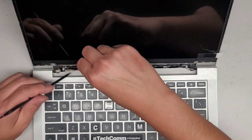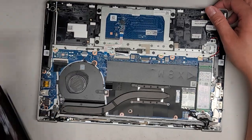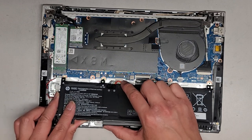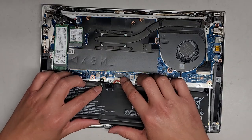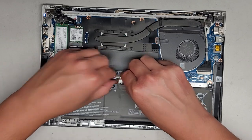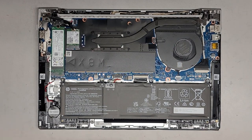First thing, we're going to test it before putting those adhesive strips back in, because we want to make sure it works — we don't want to put it all together and then find it doesn't work. Push the cable back under the cable routing guide. Get the battery back in, line it up. Make sure when you plug in the battery connector you don't plug it in upside down. Get the screws back in, then we'll power this up.